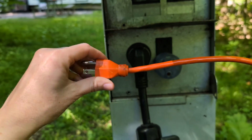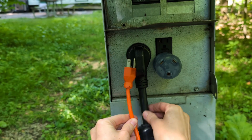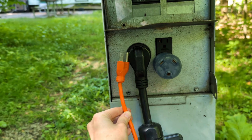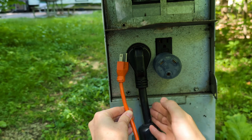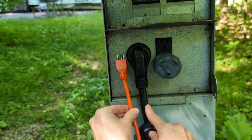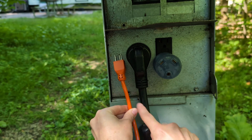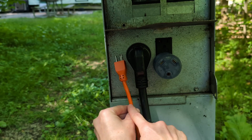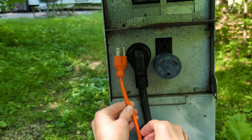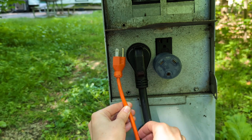Again, if you think of the cable you're using like a water pipe, look at the size difference. Using the same analogy, if you look at this pipe, a lot more can flow through it than this one at the same time. Look at the difference. This one is double the size, 15 amp, 30 amp. The numbers help you remember which one's bigger. But when you look at the power cable, you've got to think, I can only use so much electricity at once when I'm using a 15 amp connection.